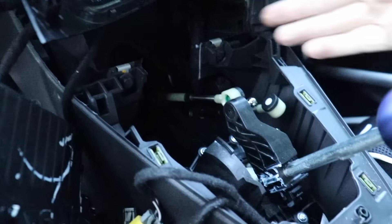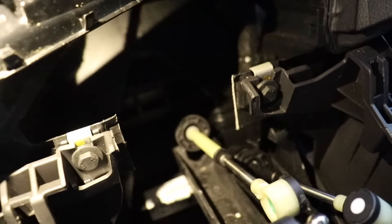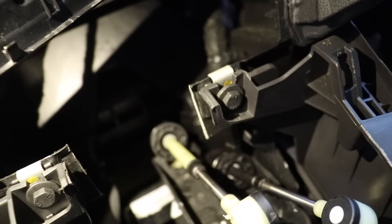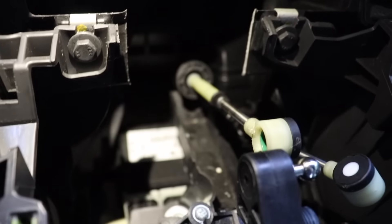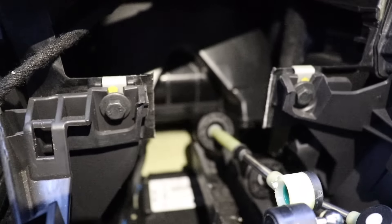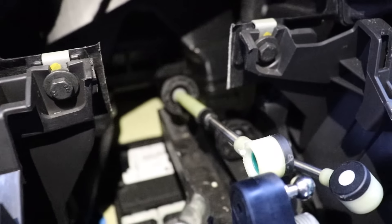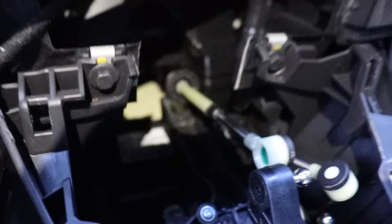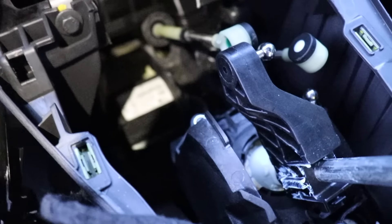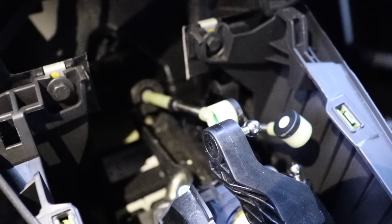Before I pull this out of the car I want to get a before and after. Keep in mind I already have a JBR short shifter on there set to full max, which is at least a 50% reduction, so my throws are already pretty short — this will make it even shorter. The instructions actually tell you to cut this center panel. I'm just using a large pair of scissors; you can use a Dremel or whatever you want. Look at all this room for activities! There's a better visual of what those cables look like under there — there's one, there's two. All you have to do is push those forward and they pop out of their little holders.